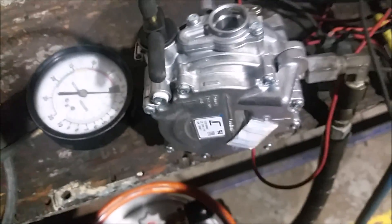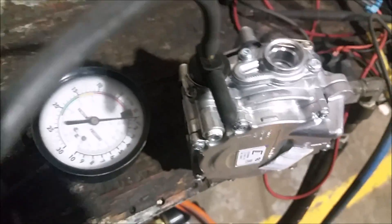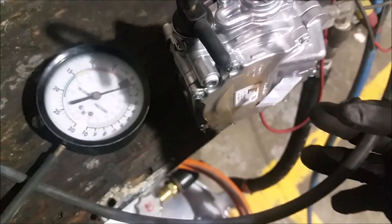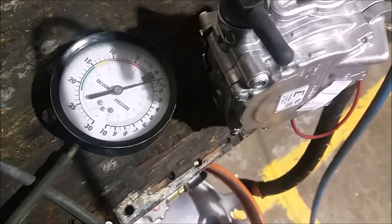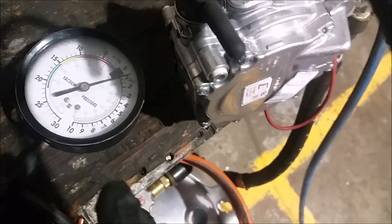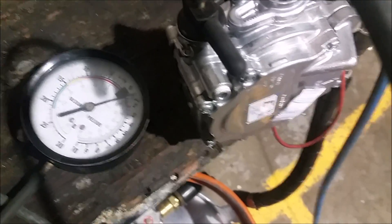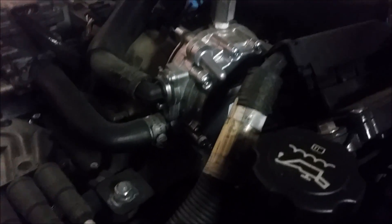I'm not going to be able to test it out in the truck just yet because there is some other work being done on the truck in question. But I think this already proves that the excessive fuel is what's causing the truck not to start. I was wrong in my assumption that it was controlling vacuum — it is actually controlling positive pressure going into the mixer. Still, the excessive amount of fuel being delivered is the cause of the no-start.